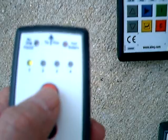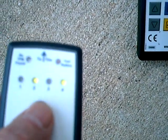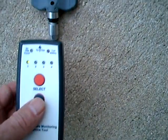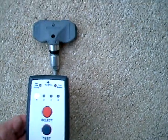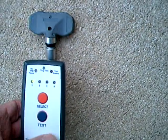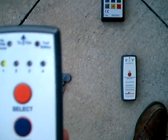With this one, which is like a Bartek Tech 300, we need to get the first light illuminated. As you progressively push and release the button, it lights up different numbers of lights. We want to get number one to excite the Corvette sensor, then push the button. What we're doing is diagnostic here to check the sensor, just to make sure it's working good. You can hear that tone from the tool — that indicates the sensor is transmitting, everything is good, the sensor battery is good, and it's ready to install on a tire.